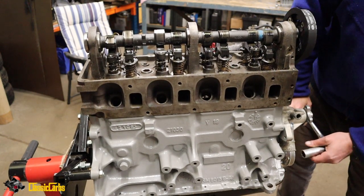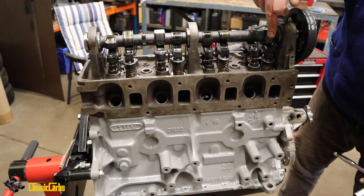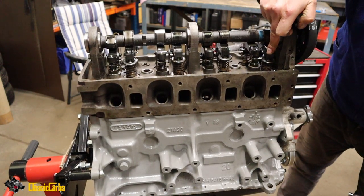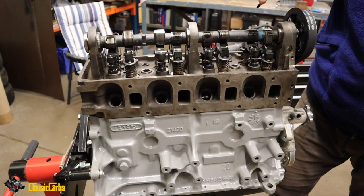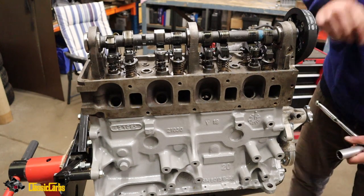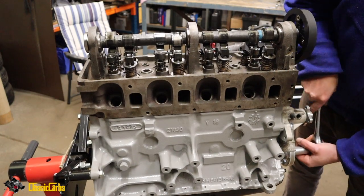Right, so this should be exhaust being on top dead. So the piston's at the top, number one, the piston's at the top, exhaust valve is, is it fully open? No, it's not fully open. But, geez, as you can see, there is no room. I mean, there's like one mil there. Do you see that? Let's see if we can replicate this for number four. I just want to make sure that everything's working as it should be. So if I do another rotation of the crank and bring it up to the TDC mark,